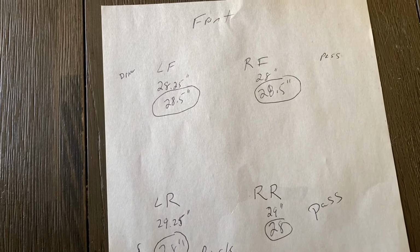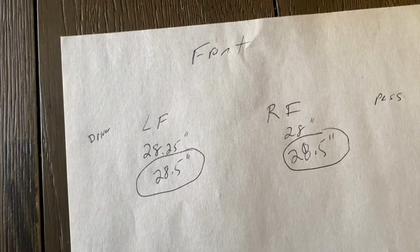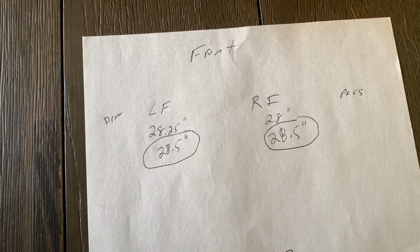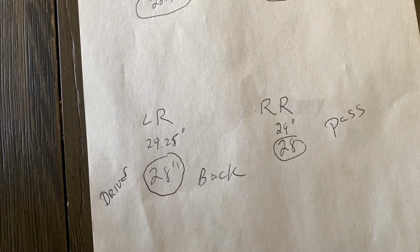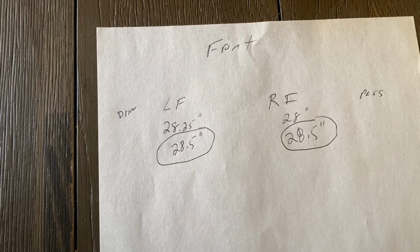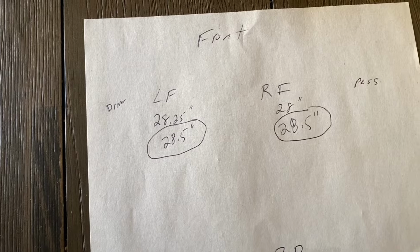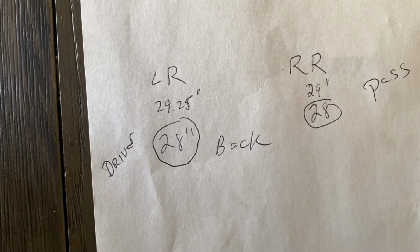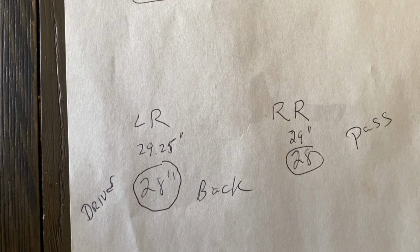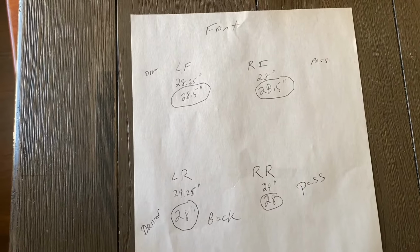And I rolled it around for a bit. And this is still staying about here, but I'm hoping that over time, the next several days, the front is going to drop down further. I'm thinking this is because the springs on the front are going to be stronger than the springs in the back, because those springs are holding up, say, the engine, you know what I mean? Whereas in the back, it's just a rear end, most you have back there going on is your fuel tank. So I'm hoping that over the next several days this will allow it to drop down. If it can drop down another half an inch, that would be great. If I get a quarter inch, I'll be, I guess, happy, satisfied. I would love for it to be right around where this is at. This is sitting perfect at 28 inches, and I hope this actually doesn't settle anymore. Another quarter inch, I'll be fine if it settles another quarter inch. But the front, I definitely would like to see them settle, hopefully, another half an inch. So those are the measurements.